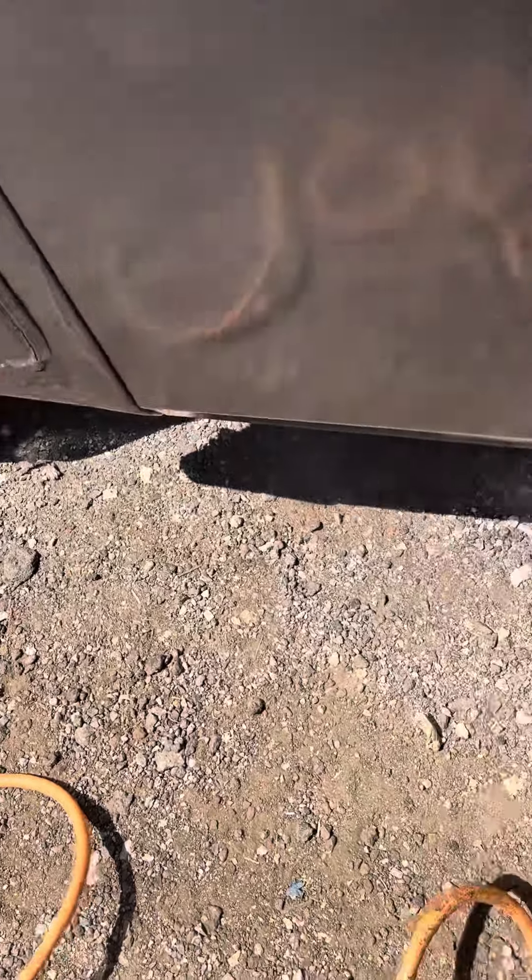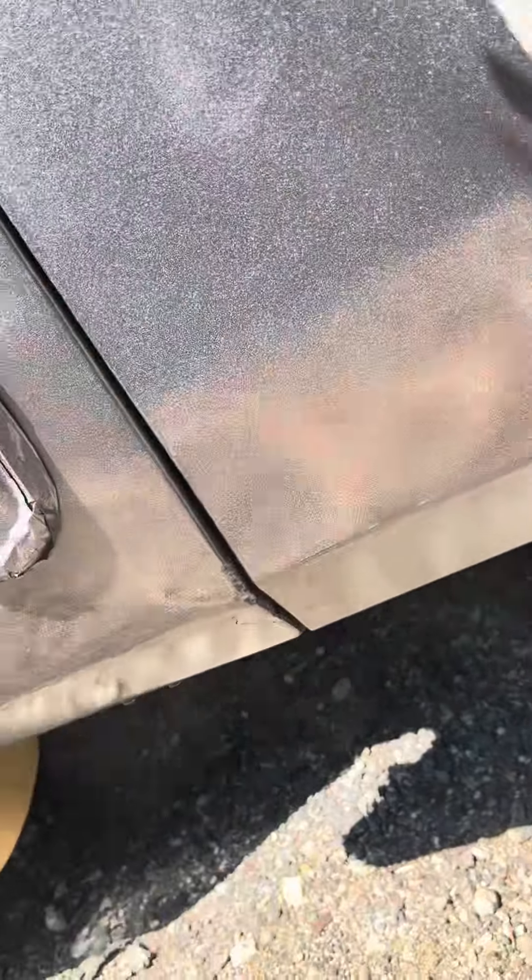That's one of the things you have to do — make sure it's really wet. A lot of painters don't know how to stop. What I do is I paint it until I see my reflection. That's an amazing way to learn how to stop. You can see right now down here there's a very low reflection, but up top you're going to see a high reflection.